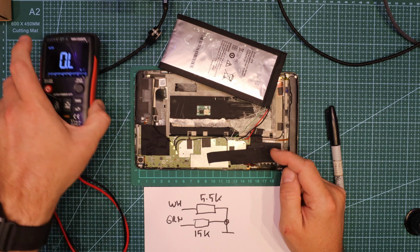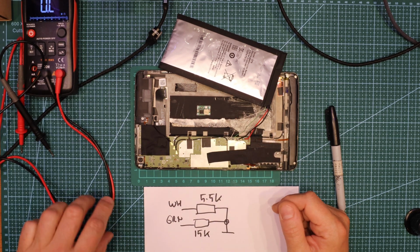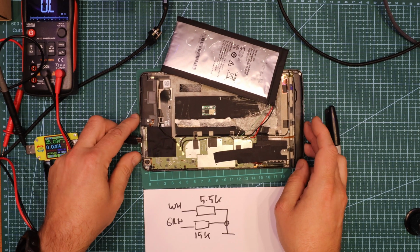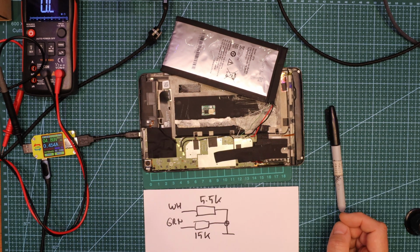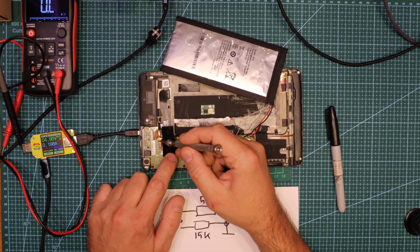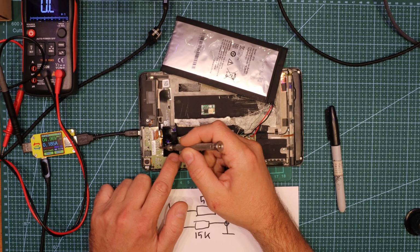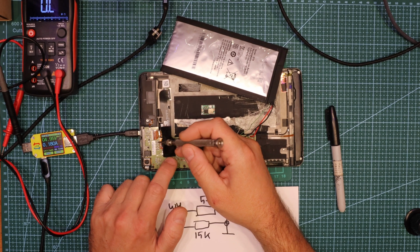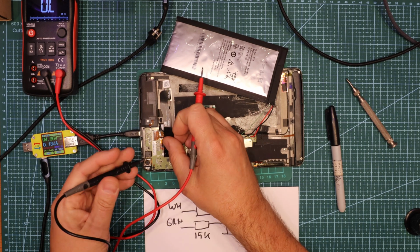We've got values for resistors. We need to find somewhere here 2 points with 5 volt voltage from the USB. This is my voltage injector. It's going here, and what I tried to do is open this, expose this fabric. Around this area there are 4 resistor-looking elements. They are not resistors because they've got 000 on them, so they act as fuses, which is a good sign for us to check the voltage.